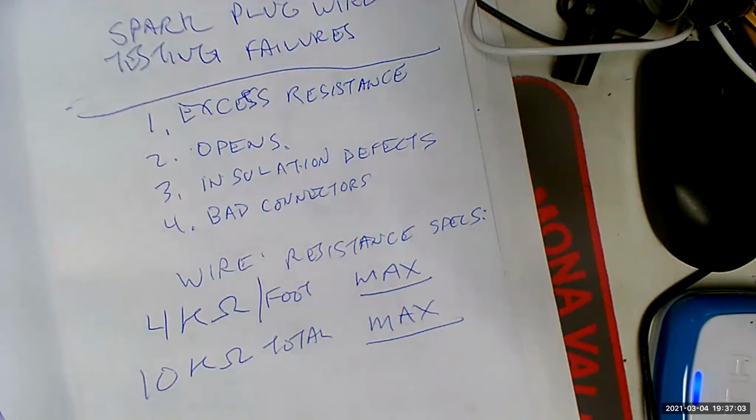Wow. So you're saying that when we see the symbol of kilo ohms, it means under 1,000? No, kilo ohms means 1,000 ohms. Okay. So we look for 1.5 on that symbol on the meter. Yeah. Or the big capital M ohms is 1,000,000 ohms, 1,000 kilo ohms.